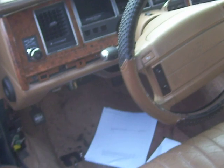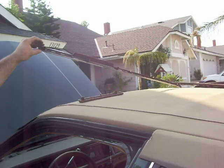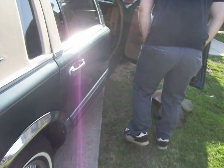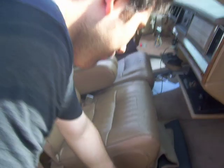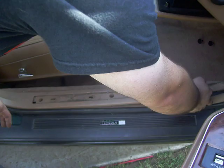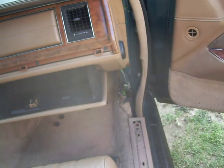Now we're going to go on the opposite side of the car, the passenger side. Up here on top of my car, I went ahead and put all the pieces — the dash and the defroster plastic piece. Going on the other side of the car, it's the same exact process as we did on the driver's side. I took off the bottom foot plate down here, then you pull this up — three screws — then you can pull this whole trim along the door down. I leave all the screws in everything so I don't forget about them and I know exactly where to go. I put a few of the screws in my cup holder — these are the big gold bolts.